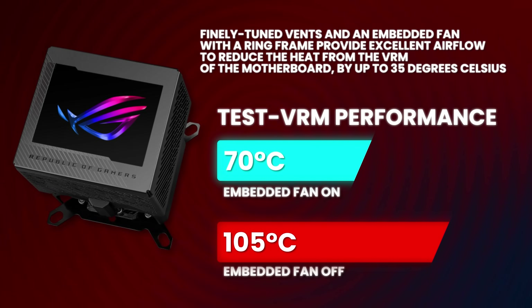There you have it — BlackRock, finally completed. What an absolute unit this PC is, not just in size but in performance as well. I can pretty much max out any game I want in any resolution and not break a sweat. The waterblock seems to be doing its job quite well, taming the 14900K and keeping the temps down under 75 degrees Celsius while playing The Finals in 1440p epic settings. Aesthetically it looks good, but it could look better, if I'm being honest. I always prefer a full custom loop as opposed to a hybrid loop where we're only cooling the CPU, but we don't have any water blocks available for BTF GPUs as of yet. I would love to eventually do a full custom BTF loop when we do start getting BTF blocks in.